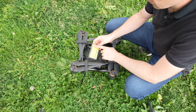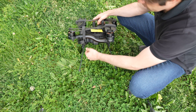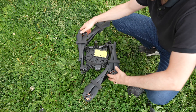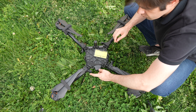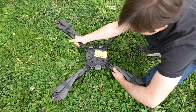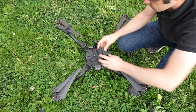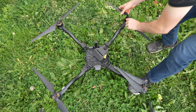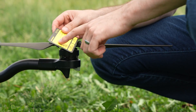Booms and legs unfold and lock. Astro fits in the hard case with the legs extended, so I'll just pull on them and check to make sure that they're fully locked. I like to open the booms two at a time to keep the aircraft balanced — open them all the way, and you'll see that each boom has a latch like this. Just push them in and they'll make a nice click when they're latched in place, and you can check by applying some force.